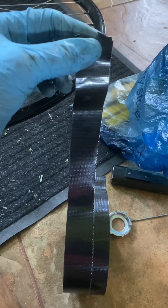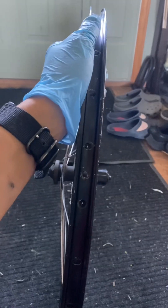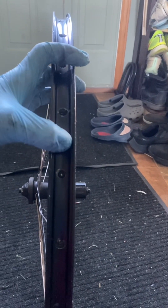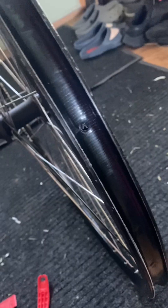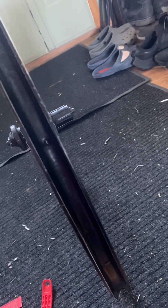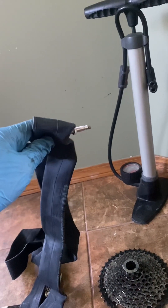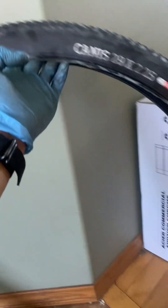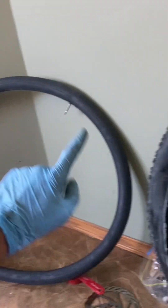Make the gorilla tape wide enough to cover all of the inner lining of the rim, wrap it twice, then punch a hole where the Presta valve sits. After lining up the gorilla tape and poking the valve hole, pre-inflate the inner tube so it makes the shape, then place it into your tire after confirming the inside of the tire is free from anything sharp that could puncture the new inner tube.